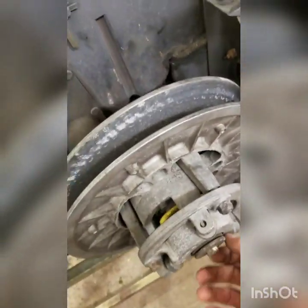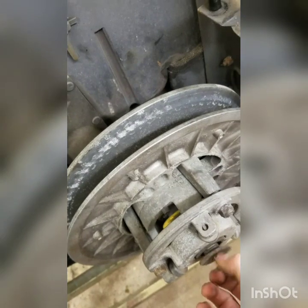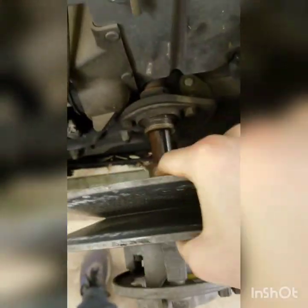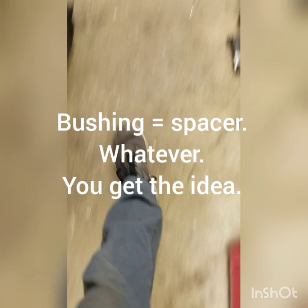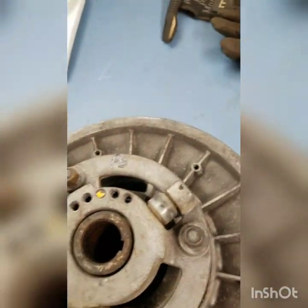Let's start with the secondary. First remove your bolt — strong fingers. Pull out the bushing, pull off the clutch. Make sure you don't lose the keyway pin. There it is. Lay it with the bolt and the bushing. Put it on your bench and mark the thing so you remember what it's for, otherwise you lose it in this mess of clutches you don't remember.